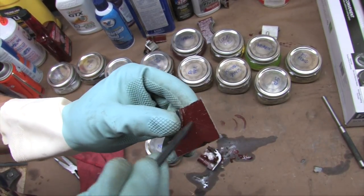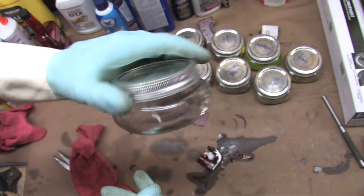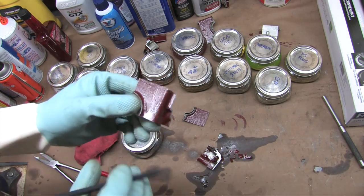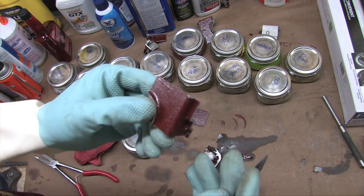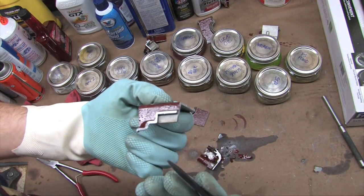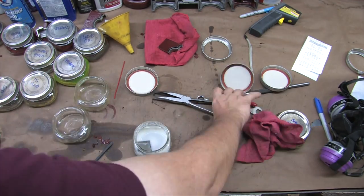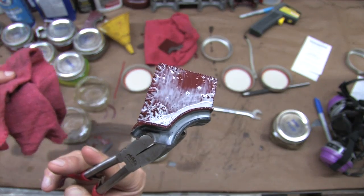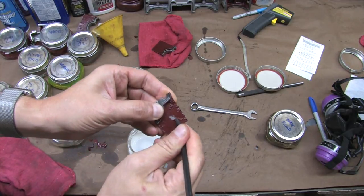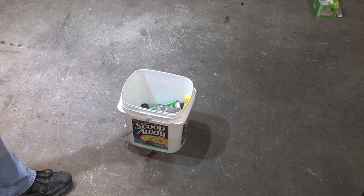Revisiting ether: after all this time, the surface of the Glyptol is still completely intact and unaffected. Perfectly safe to spray into your intake if you've coated your internal parts with Glyptol. The foamy engine degreaser, however, after a full 24 hours of soaking: the coating's polymer structure is compromised, the paint has begun to expand and wrinkle, and the spudger can easily tear it away from the metal. It's soaked in and dissolved the paint. Don't use foamy engine degreasers on Glyptol-coated parts.